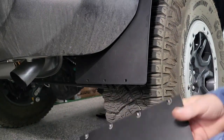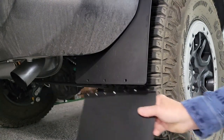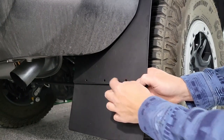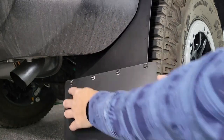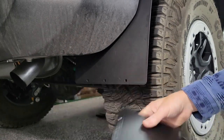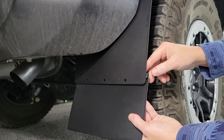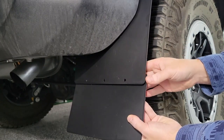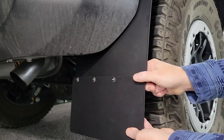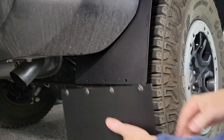Next we're going to put the extension on. You could put this on the outside or the inside. The only difference is if it's on the inside, it might look a little cleaner because you only have your screws, whereas on the outside you're going to have four of these and a ledge back here. With the rail on the inside like that, it's going to give you a spot where you'll be catching debris — so if you're in snow or anything like that, it's going to stack up on top of that. The best performance would be with the rail in the back, so everything just slides off and you won't get any buildup on the top edge.